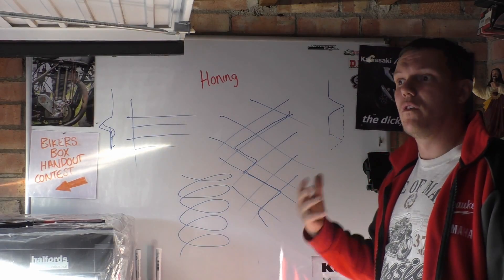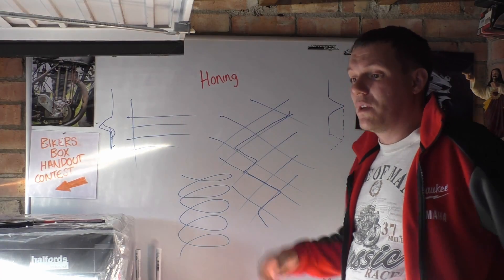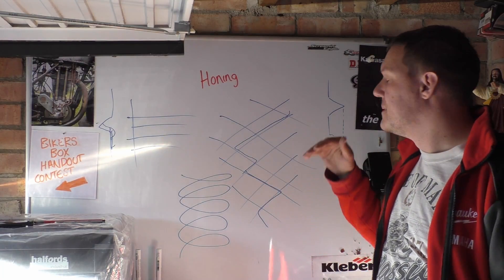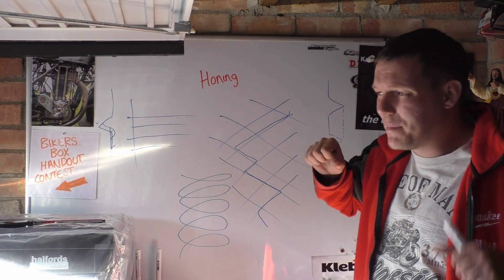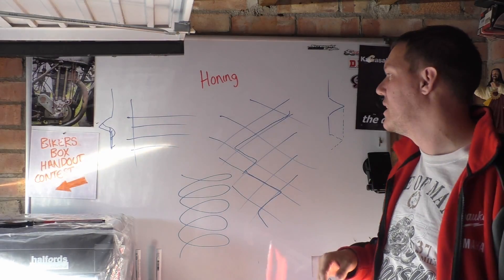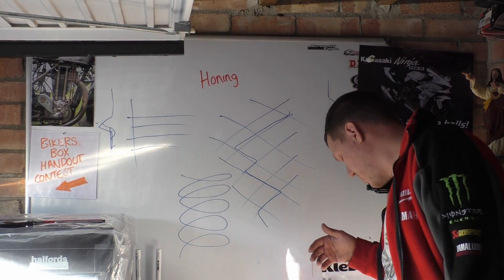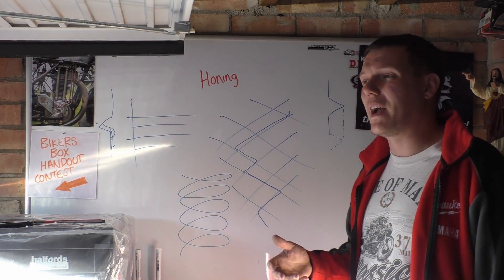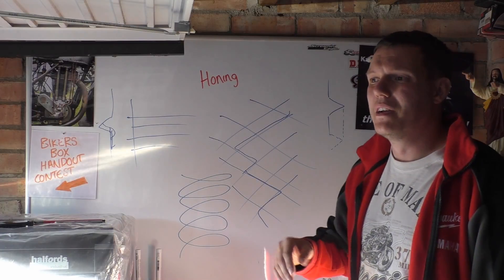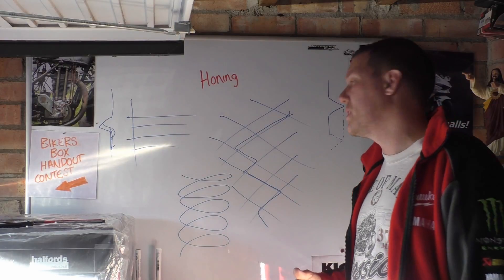This means your cylinders won't be over-oiled. One of the reasons you don't want over-oiling of a cylinder wall is that you do not want your rings to glide completely on oil. If you do that and your rings aren't basically forced against your cylinder wall, you can quite early on start suffering from ring flutter — I'll do a video on that in the future. And all sorts of other problems: burning oil, cylinder sealing issues, you can get a lot of gas blowby if your ring is literally floating on a pool of oil. You don't want to start burning oil like it's going out of fashion.